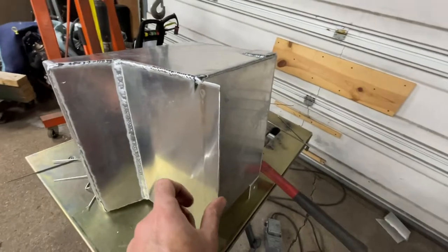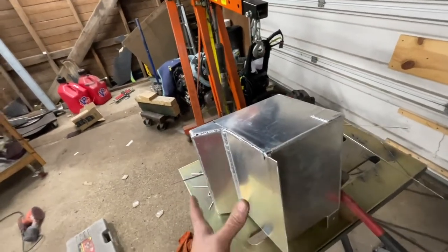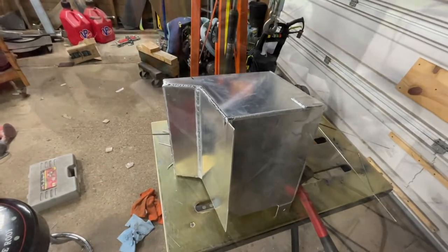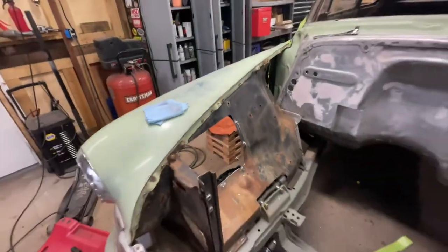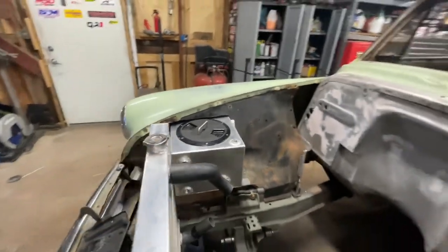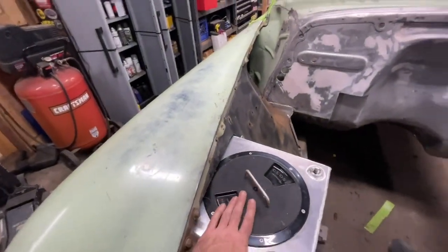I left this flange on here because it's going to be on the outside of the inner fender - that makes sense, you'll see it later - and then I'll bolt it to that. I'll do one clamp on each side to bolt it to the fender too. I've got to weld those on yet, but I don't know where they need to be yet. It's really hot right now so I'm going to wait until it cools down and then put it on. Got the mounting flange welded to it and the back ones bent to fit, opened up, with nutserts - threaded inserts - right where they need to be. Bolted it up - plenty of clearance. It's got a nice even gap between the radiator and the tank.